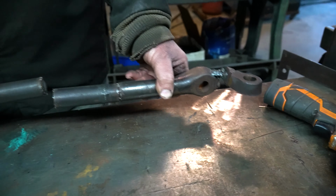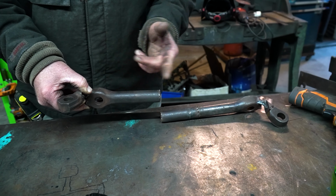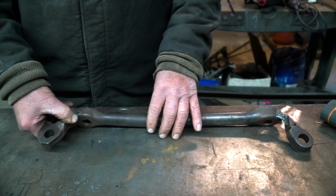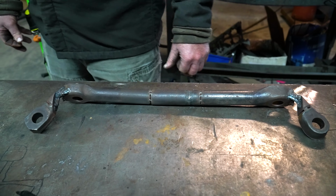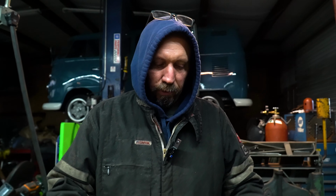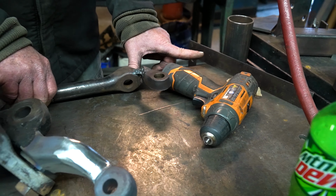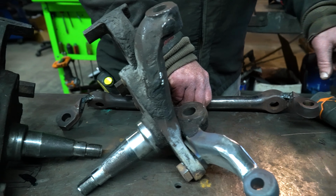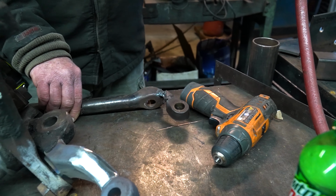Yeah, even the height and how far back it was going, and to get that, like I said, moving an eighth of an inch really changes a lot of everything. So, yep, that's perfect. I mean, Ackerman is not something you adjust ever. It's not like an alignment thing that you adjust out. It's built into the suspension and it's done. That's why people don't even really know about it. But the bump steer or the toe, that's done by moving this side up and down and this side up and down, getting everything just right, and the length of the tie rod.